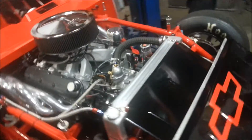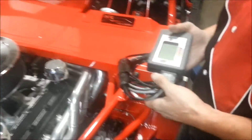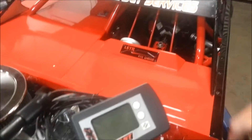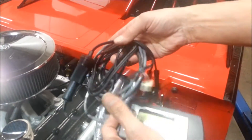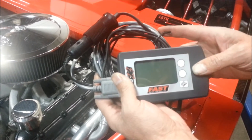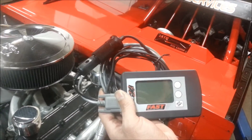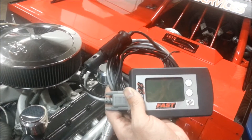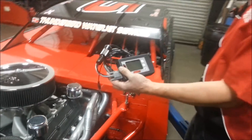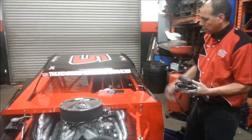So there you have it. I'd like to show you the handheld that comes with this unit. These units you can buy from us here at RC Engines for about $19.95. This actually plugs in onto the ECM with this little connector right here — very simple to plug in, then a power source — and you can just scroll through and do all your programming. It's very minimal. This has got a wideband oxygen sensor on it, so it's self-tuning. We figure somewhere in the neighborhood of 15 to 25 laps, it'll start putting in meaningful fuel mixture numbers that will self-tune and keep it under control.